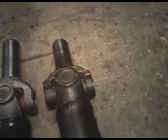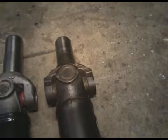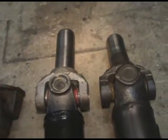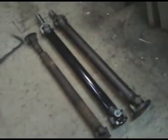Whereas the stock Chevy uses an internal C-clip that's inside the yoke — actually it's injected plastic originally — they use a slightly smaller one but it's an external C-clip, so it works the same way the old MG shaft worked. Nice, beautiful, lightweight shaft. The thing actually weighs less than the B-shaft. Amazingly, that big tube is lighter. I'm real happy.